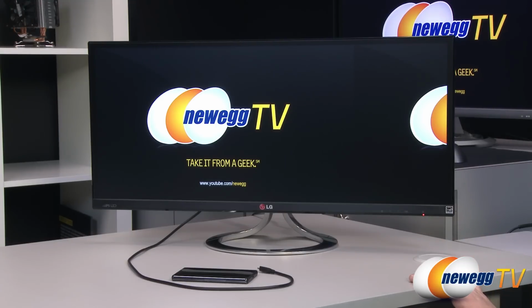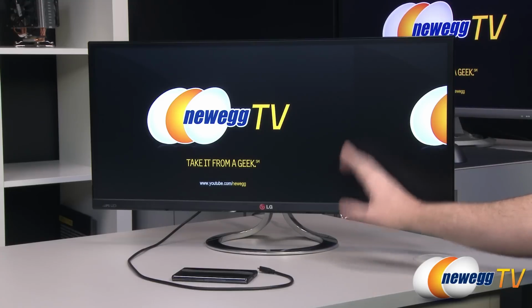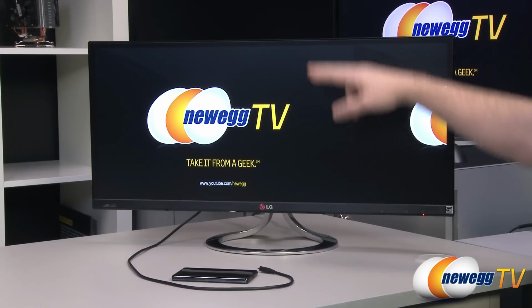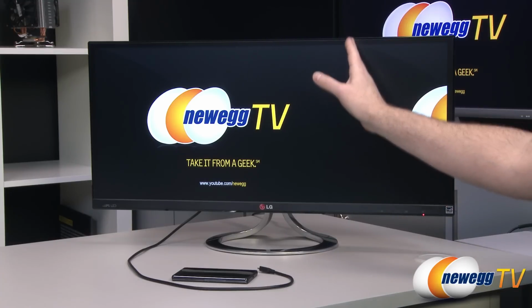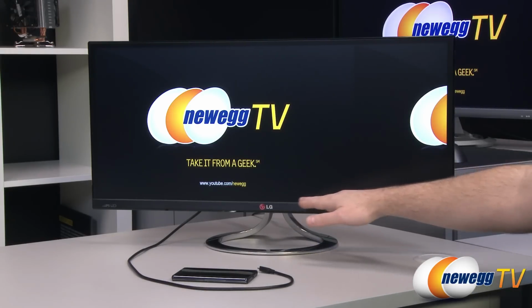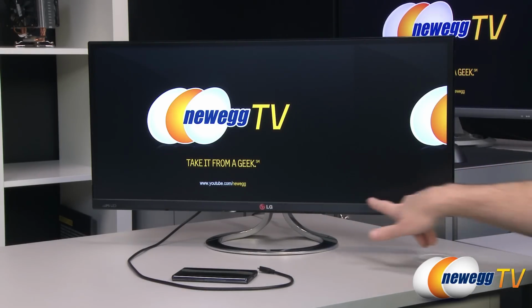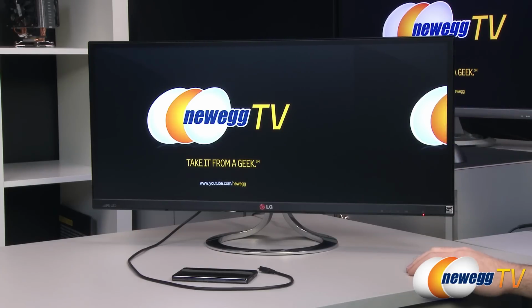So very customizable monitor. What we're looking at right now is our standard Newegg TV background image, and this is a 1920 by 1080 resolution image. Now if you can see this little vertical line right here, that is where the image starts duplicating. So you have 1080 vertically, and that stays the same across. Up to here would be 1920 by 1080. This one, of course, extends all the way out to 2560, so that should give you guys a better idea of how much horizontal width you get with the 21 by 9 resolution monitor.